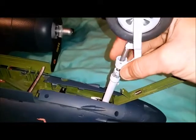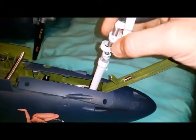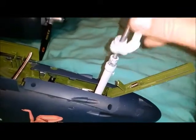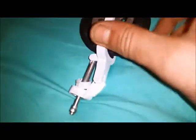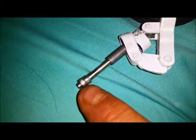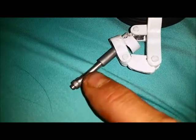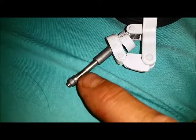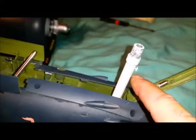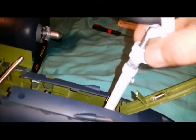They're stuck together with paint. See if I can get them to pry apart here. They won't. Yeah, this collar right here, because I painted my struts white. So, get it down here. You can see that the piston has got a shallow part into it. I'll come down in here, and that stopper. And you can see this second stopper right here, which I machined and put on there to decrease the travel distance. That travel distance is controlled by this screw. Put it back up on here, kind of show you what I'm talking about here.